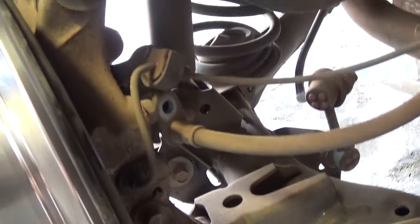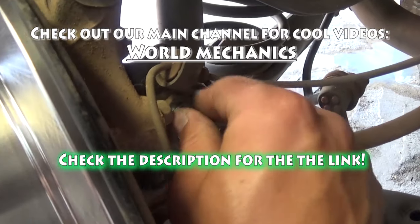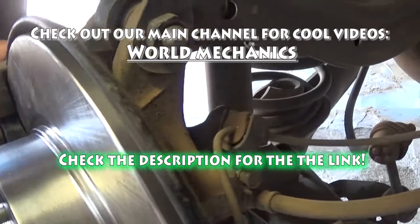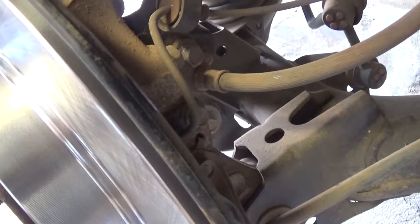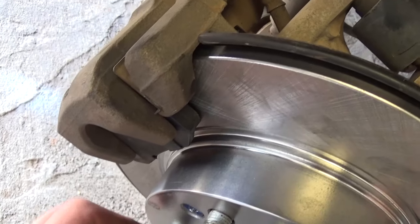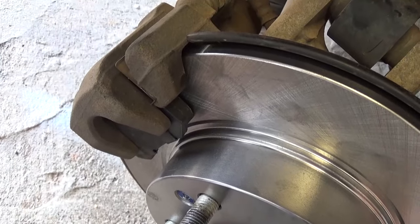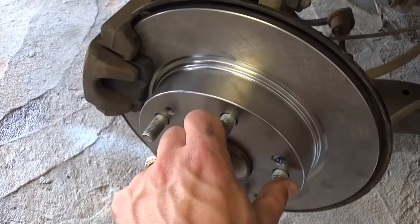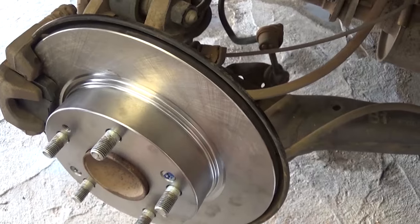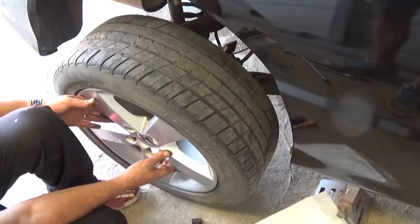Make sure this piece goes underneath that plate, then get the two bolts on the back — one on top and one on the bottom — nice and tight. After that, don't forget to install the bolt on the brake line, because otherwise you could damage the brake line and lose the brakes. Hit the brakes a couple of times to move the caliper into position until it holds. Thank you guys for watching — the same procedure applies for the left side. Don't forget to subscribe and give us a like!